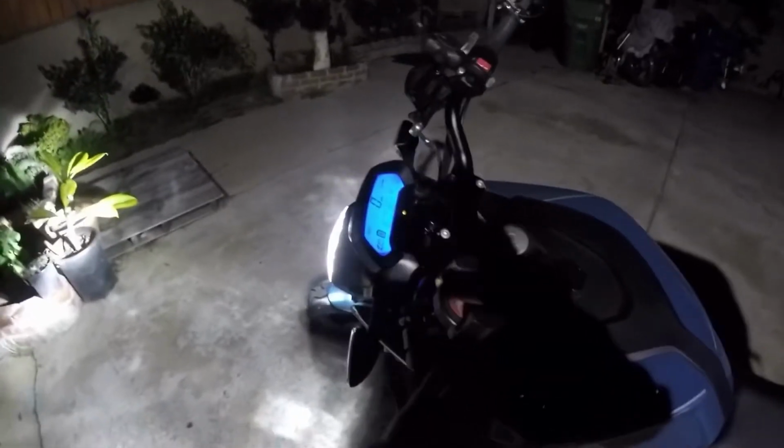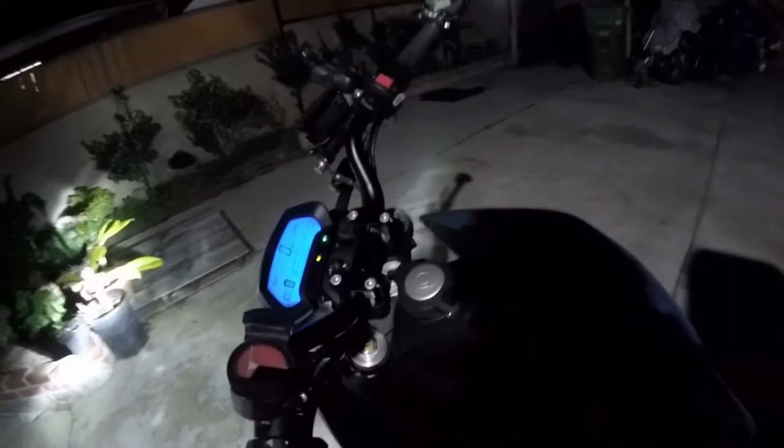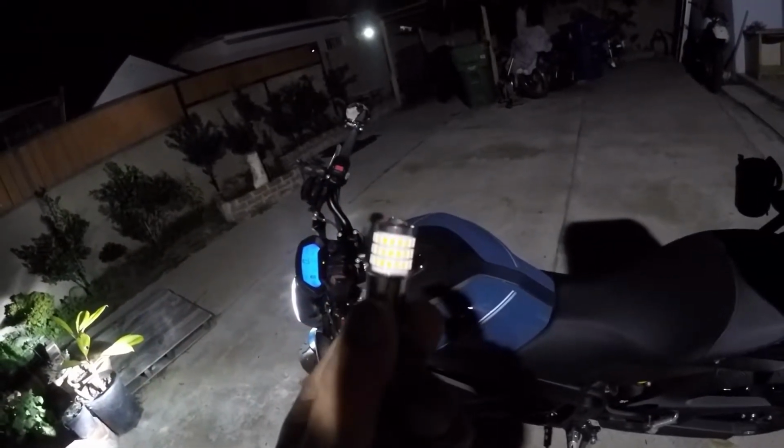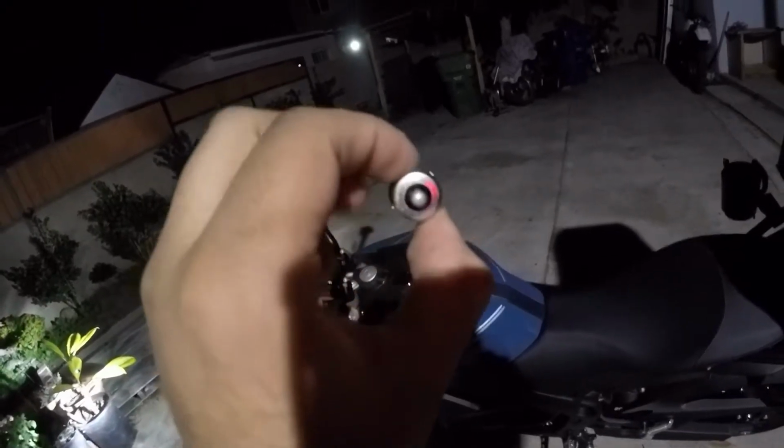Yes, I know if I don't put in a resistor, it is going to hyper flash, because right now obviously it has the slow pattern. And when putting in LED, so I found bulbs. I'll put a link in the description in case you guys do want to see. It's an LED bulb. There you go. You can see there. And it is just the offset pin, just like the stock one.